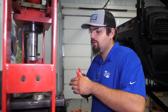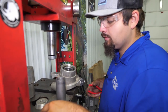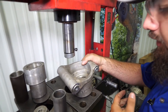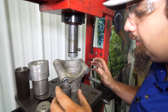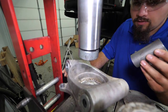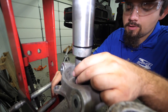Now we're going to remove our wheel bearing from our factory bearing carrier knuckle. Remove our snap rings, and you want to find something you can press your bearing through — this cutout on our plate is perfect for a wheel bearing. Make sure it's centered up perfectly, find something that sits on the inner race, and start pressing our bearing out.